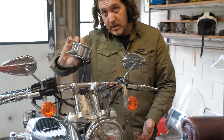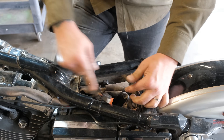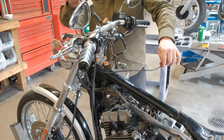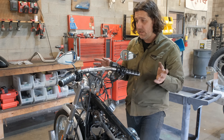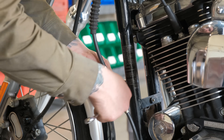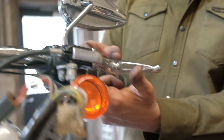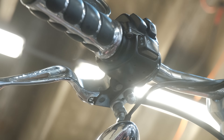Right now this is the only thing holding me to the wire harness, so I'm going to follow these wires back and see if there's a plug — and there usually is. It goes all the way back to this plug here. Hopefully now I can get all the handlebars off without cutting any wires. Don't let this nest of wires intimidate you at all. As long as you don't cut anything, you should be fine. To get your clutch cable off the perch, loosen the adjuster here to give yourself some slack, and then you'll be able to take the lever off the top.